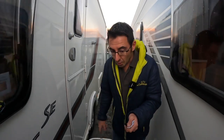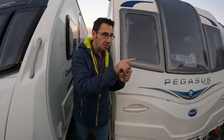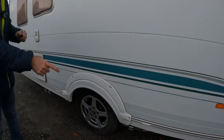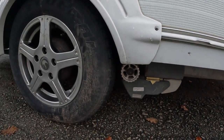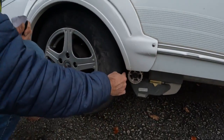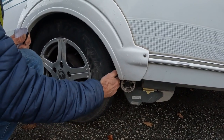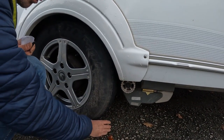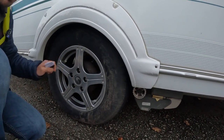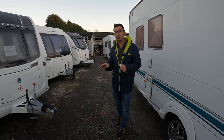You don't want to leave the motor mover connected, because that's going to put an indentation into the tire. If you think you can connect the motor mover to the wheels and take the handbrake off to stop it moving, the problem is the roller will be pressed against the wheel and cause damage to your tire. Make sure the motor mover is disconnected, use a chock — either a brick or a proper chock — at the front and back of both sides, then drop the handbrake off and that should stop any issues.